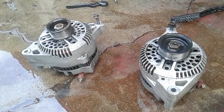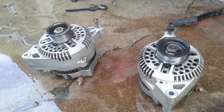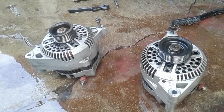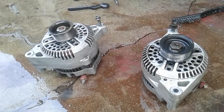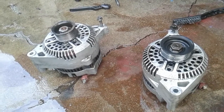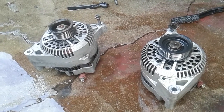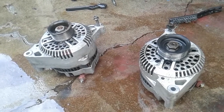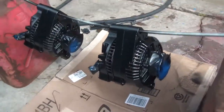The 2G was the only alternator where the belt wouldn't slip. I'd wanted to do a serpentine conversion for a long time, and now as part of that I'm getting this better 130-amp 3G alternator. Next step will be wiring, probably tomorrow when I have more light. $48 for two — now I have a backup, so there's less than a 50/50 chance they're both bad.